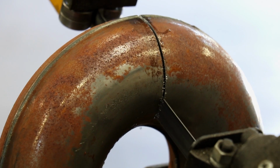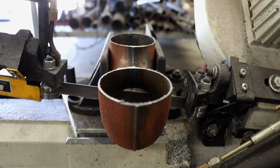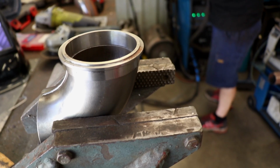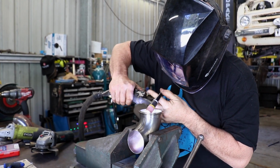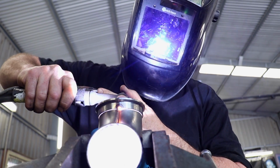Al cuts up a 3-inch mild steel donut. This gives him 4 tight radius bends to work with. Starting from the turbine housing, one bend is tacked onto the V-band, and Al can then snake his way down around the engine mounts and under the sump.